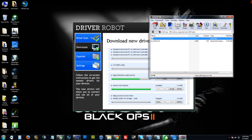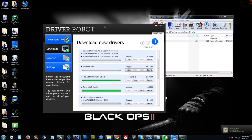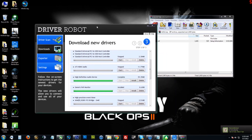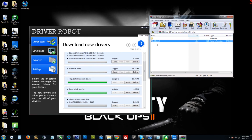If you're a computer technician, you should know what to do with INF files. Go to Device Manager, right-click on the device — the Generic PnP monitor in your Device Manager — and set it to find this file, which you can drag to your desktop for the time being, or extract it to whatever location you want.